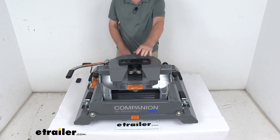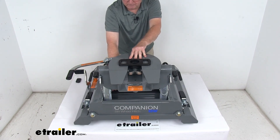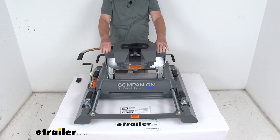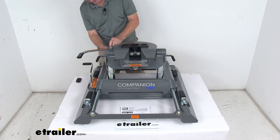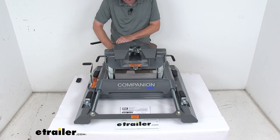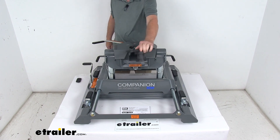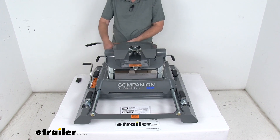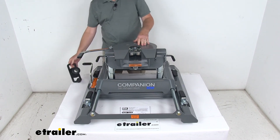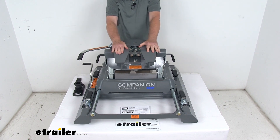When you're ready to get back on the road, just unlock the slider and back up to bring the hitch closer to the cab. It automatically flips into the lock in the towing position. To unhook, open the pin and clip, rotate the handle back, and there's an extra hole in the back where you can drop the pin and clip through to hold the handle with the jaws open, so the kingpin slides right out. That covers the review of the B&W Companion OEM fifth wheel trailer hitch with the slider.